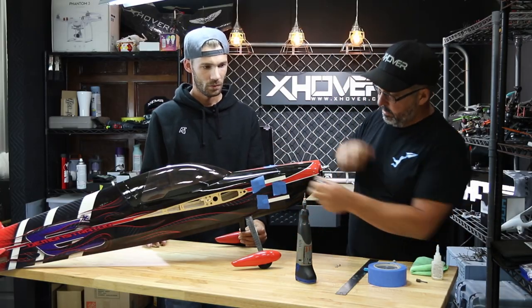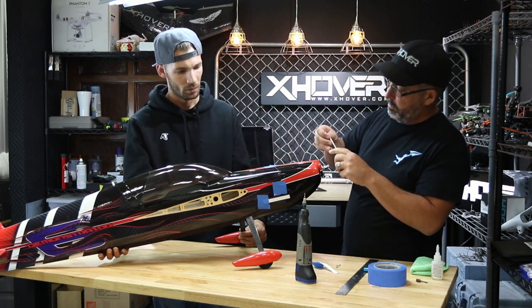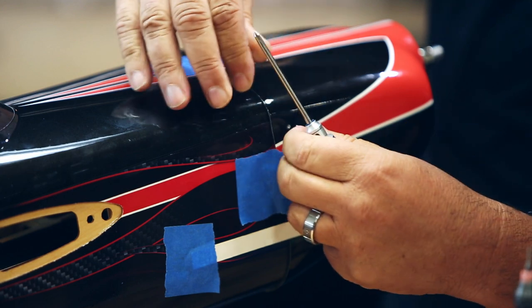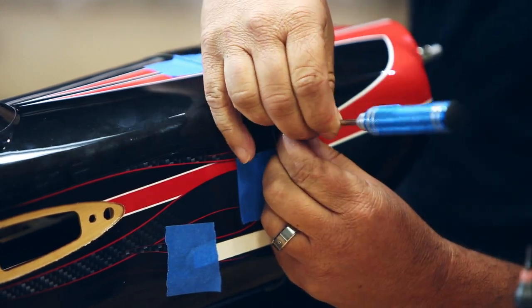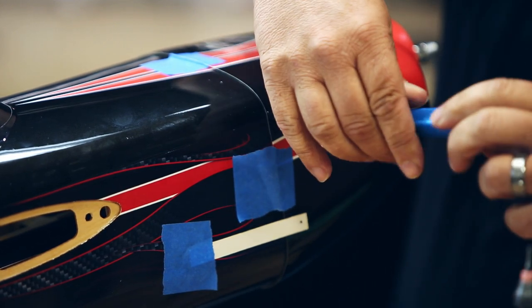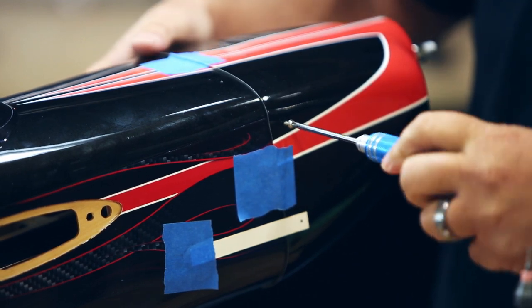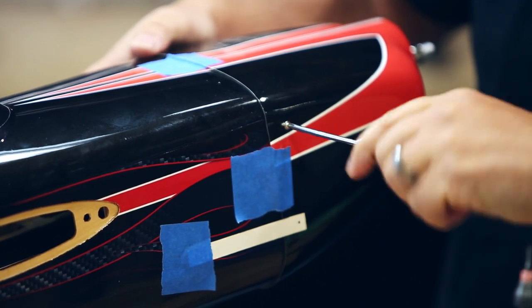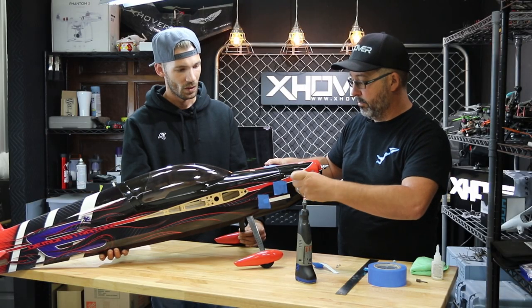Take one of the screws included in the kit. Once this is drilled we can pull the tab off and put it in. The reason I put it in one screw at a time is once that screw is in, it's locked in place — the cowl is not going to move. The tape can move a little bit. As we go we can just keep checking our centering on the motor and make sure it's where we want it.